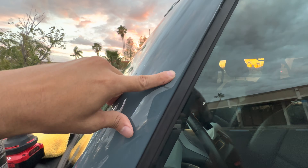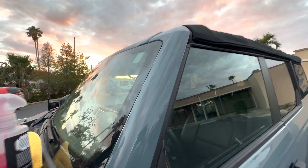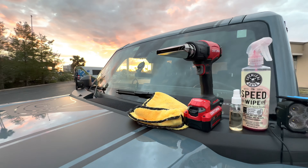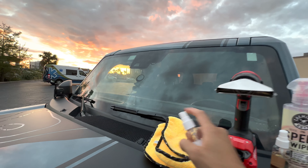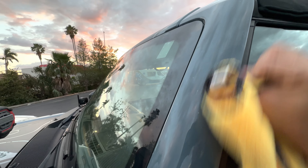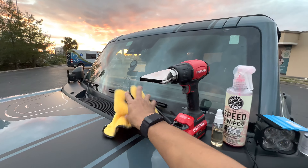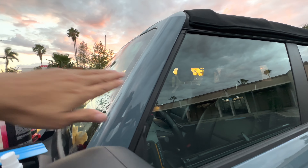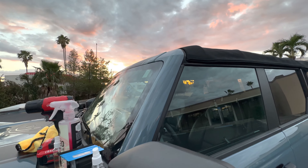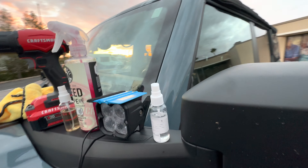Usually the removal fluid is to get out marks like this. This felt-tip squeegee has glue in it, and if you push hard enough you will leave marks. But I'm going to show you real quick that those can easily be removed with our Sticker Fab fluid. I'm going to spray a little right there and rub it — it has that citrus smell. You might think you're scratching the PPF, but it's just leaving a little bit of glue residue behind. It's really easy to get off. When you use that fluid, you want to clean the area entirely and any exposed surfaces it gets on, because the nature of the product is kind of destroying that adhesive.